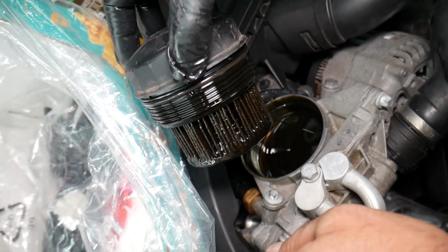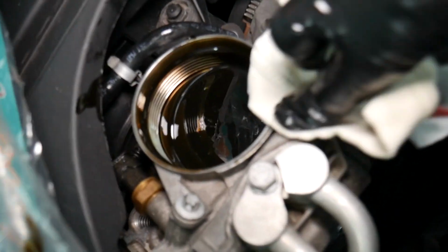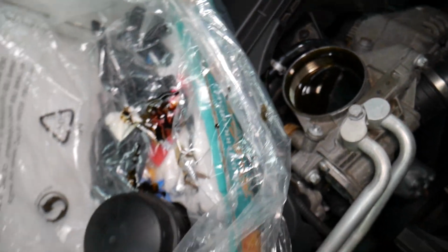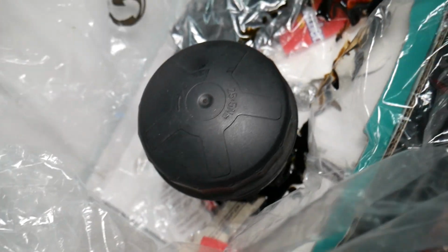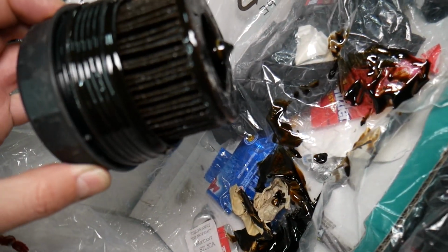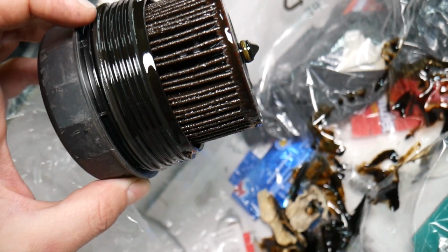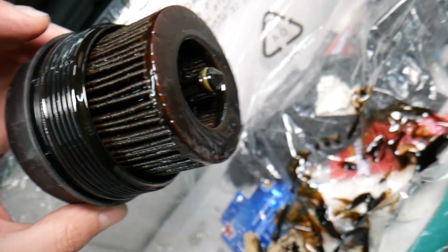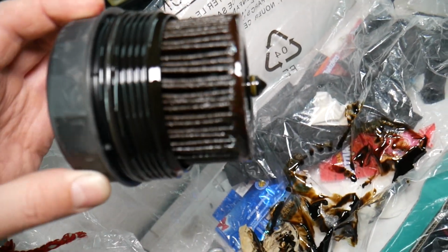We're going to get it here in the bucket. And you can see it's out, guys. Okay, it's slowly going out now, okay? So all that will leak back in the oil pan. So here we can continue with the next step, and that will be to replace that filter now. We need to replace the seals here, that big seal, the little green seal that you see on the front, and the filter itself will need to be replaced as well.